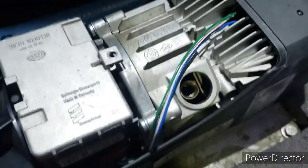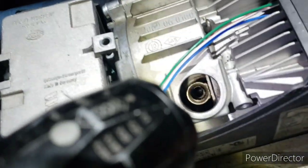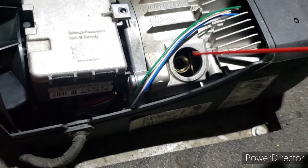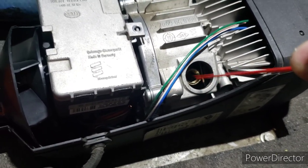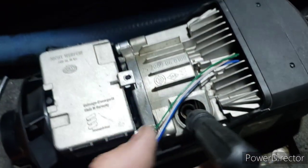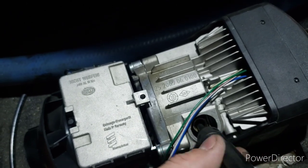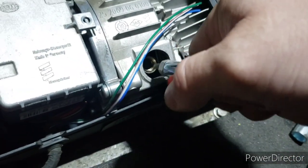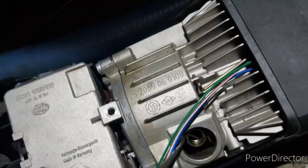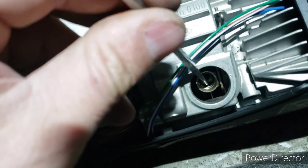There's a mesh inside but I don't have a replacement right now. I'll spray it with brake cleaner real quick and clean it up a little - I don't want to pull it out so I don't mess it up. I can use the screwdriver a little bit but not too rough, not to mess up the mesh. I can also use compressed air. The hole is clear now - the pick goes through. That's the air supply for the ignition, so make sure that's clean.